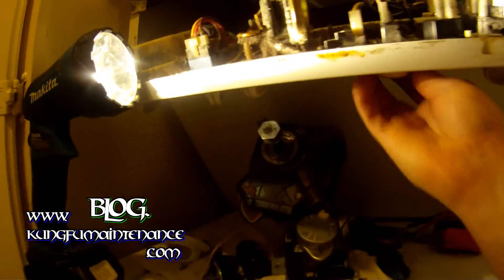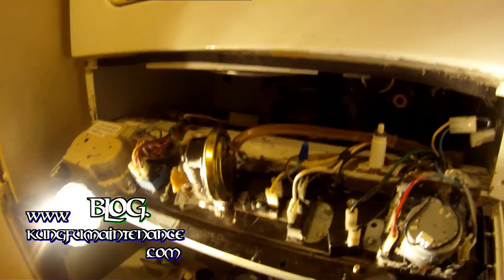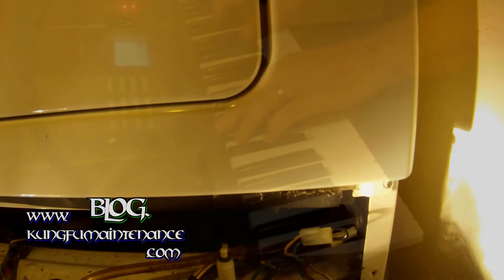Once we start it, we'll just need the push button to start the dryer. Here it goes — reset the power and we'll hit the push button. Now we'll just push the button to restart the dryer. That's how we can test and prove out whether it's the door switch that's malfunctioning.